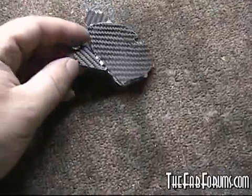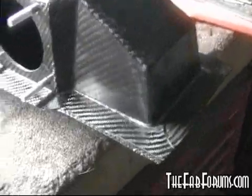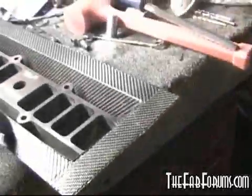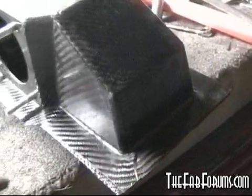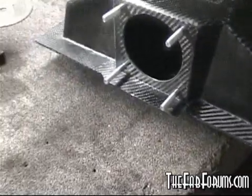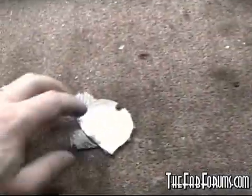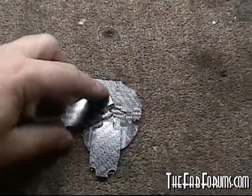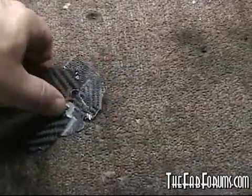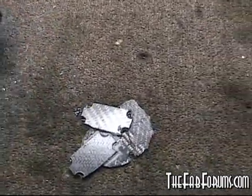I've also been testing some epoxies to figure out what I'm going to use to bond the upper and lower together. I've decided to put a thin bead of epoxy around the flange and just sandwich the two together while it hardens. Then I can cut it back close, sand it nice, and it'll be one piece. I don't think I'll ever have to take it apart — the upper and lower should be able to come off the motor together. I took some cutoff pieces and did some test patches, and found that standard 5-minute epoxy in the tubes doesn't hold very well — it just pops right off.